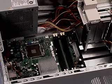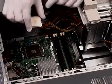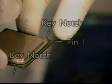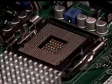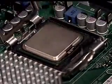To insert the processor onto the motherboard, orient the package so that the integrated heat spreader is facing up. Pin one and the locating key notches on the substrate must be oriented properly. A yellow triangle indicates the location of pin one. Carefully lower the processor into the socket, taking care to align pin one on the processor with the socket. Holding the processor with two fingers, lower it with a vertical motion.